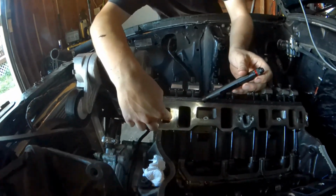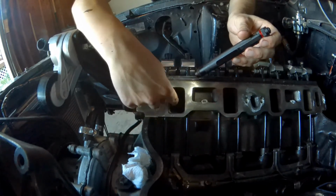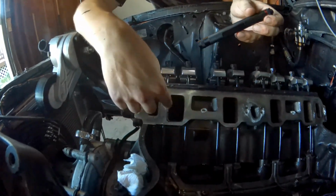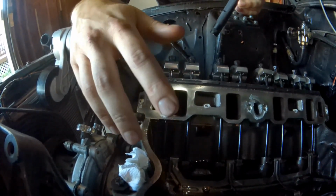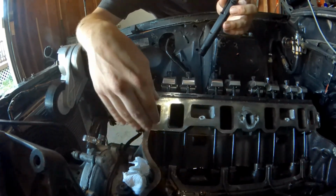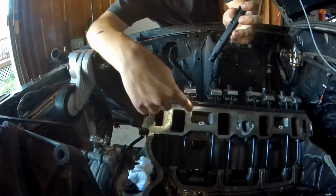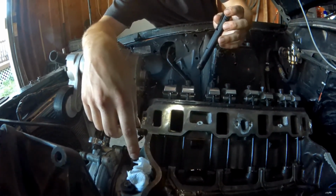In theory, I assume that coolant was being pulled from here into this intake port, and same for the other side. And I have a pretty lumpy cam with some decent duration, so during low speed idle, the vacuum pulses from the intake stroke probably moved the coolant throughout all of the cylinders, and that's why I found coolant in all of my cylinders.